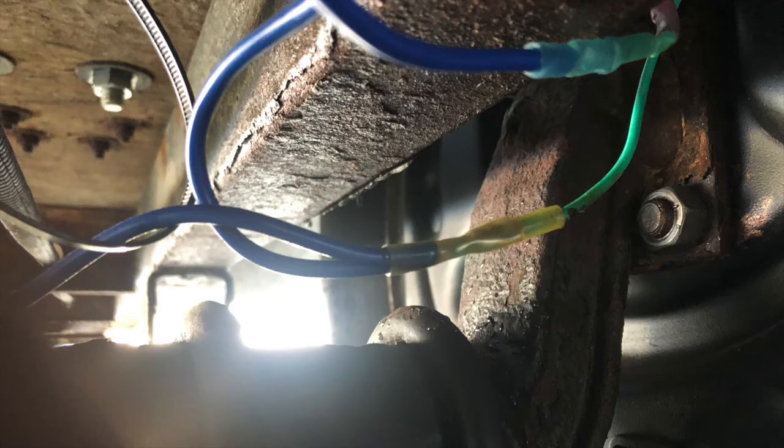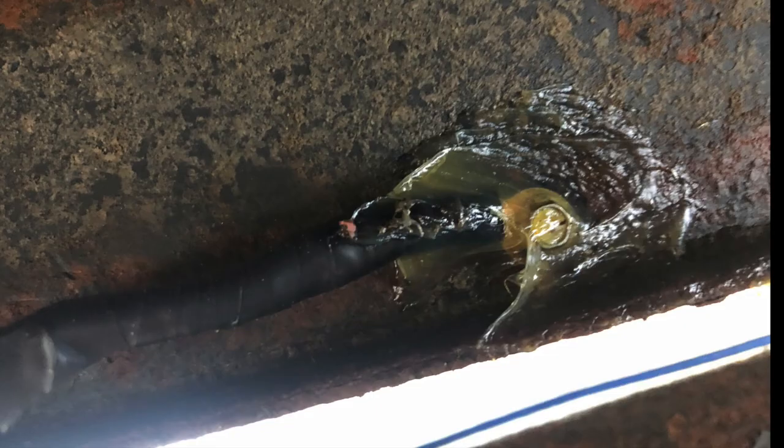As far as the electrical goes, I had to upgrade to a 7-pin plug. I purchased 12-gauge automotive wire and ran it along in the existing loom down along the bottom underneath the trailer, connected them to the green wires on the electric brakes with shrink wrap butt connectors. You don't need to worry about which one's positive or negative — either one will work, just put one for positive and one for negative.